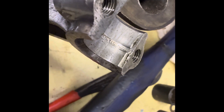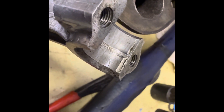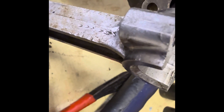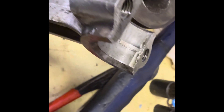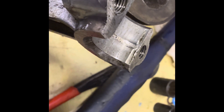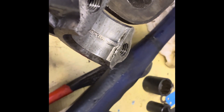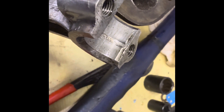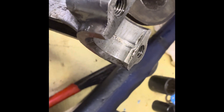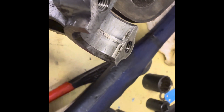There's our damage, just there on the big end. You can see that burr there — it's indented so it's obviously been damaged by something, perhaps dropped. You can see it's been clamped in a vise or something at some stage which has mauled it up quite badly as well. That's where the damage has come from — that burr has obviously been trapped in between the bearing and the crankshaft. It was probably never run when it was put back together, and on that first run the burr came off, went into the bearing and caused all of that. But it's only in that one bit — I think we can dress that up, get rid of that burr with a file, get some emery paper in that bearing and get it smoothed out. I think she can go again.